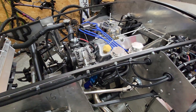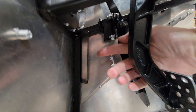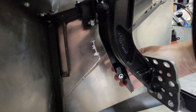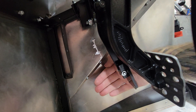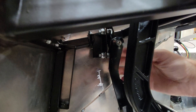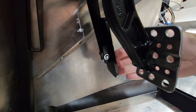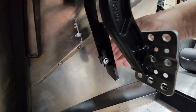That's the idler pulley. I didn't like where the throttle used to pivot. The mount was on this plate here, and when you'd push on the throttle it would go more down — the way the sweep was. I didn't like that because the other two pedals go straight back. I whipped up something out of angle iron and moved the mount, so now when I push the throttle it goes straight back, not down and back at the same time. It feels a lot better.